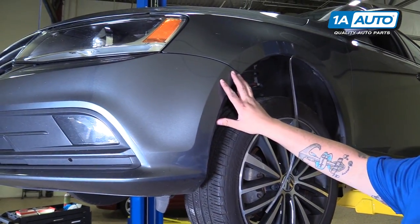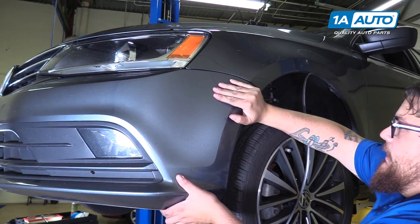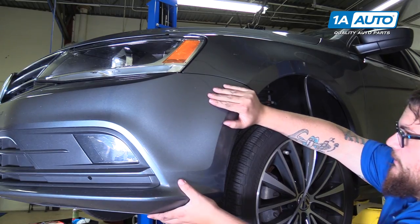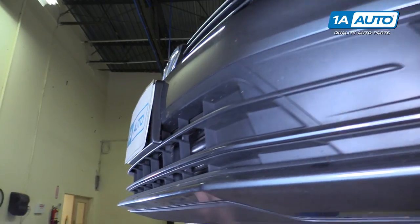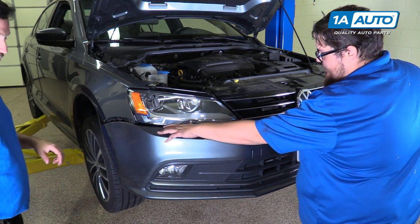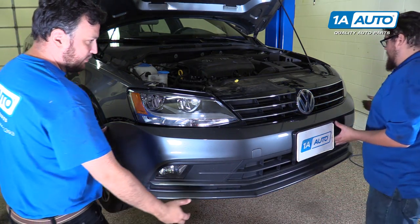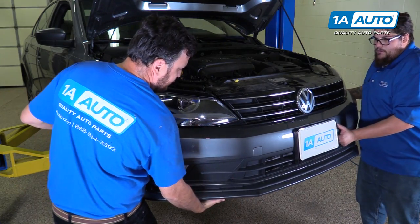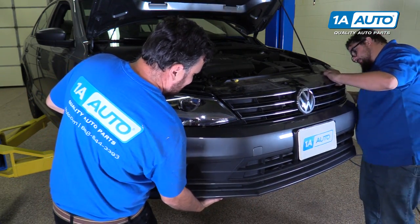When you need to remove the front bumper itself, there is a guide along the back of this bumper. You're going to want to apply some pressure forward to get it out of the guide, and then it's all going to come straight out. To finish removing the front bumper after you've got the side guides out, you're going to want to pull forward. You may need a second person to assist in evenly pushing the front bumper out.